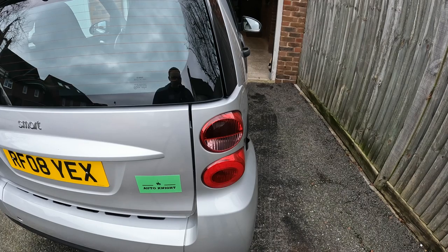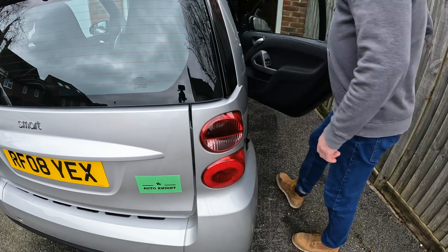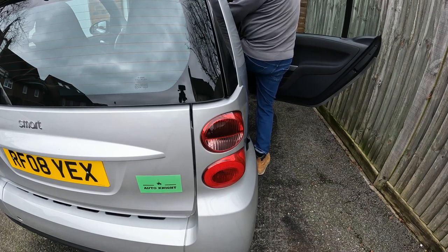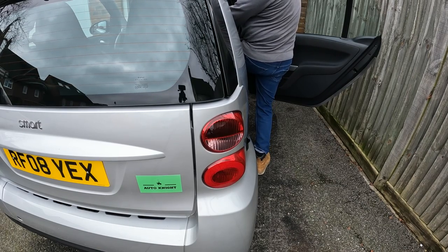The first thing that crosses my mind is that selecting gears depends upon there being a signal from the brake light switch. So my first thing to check is: have we got brake lights? Let's see if we've got brake lights. That's definite — no brake lights.